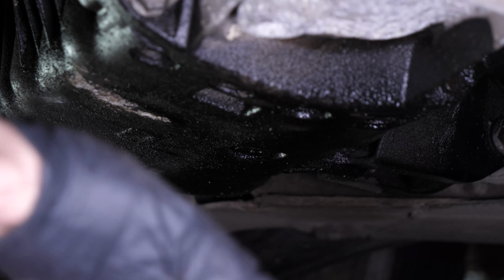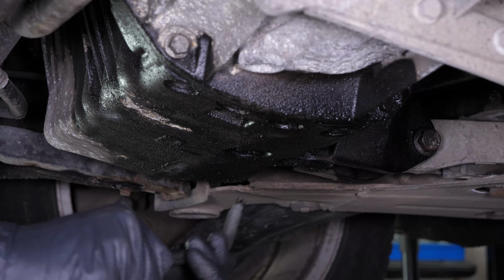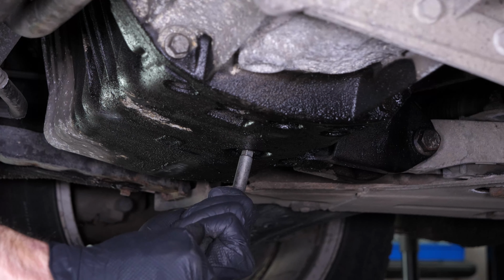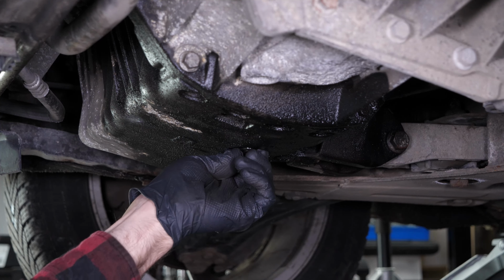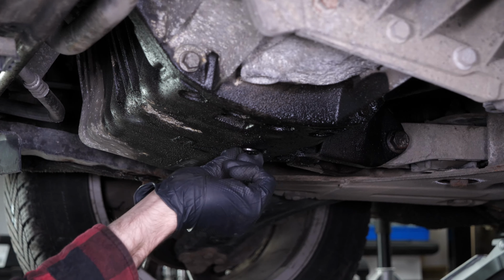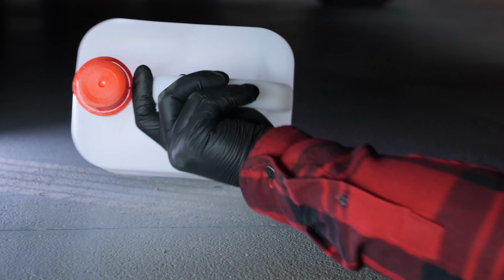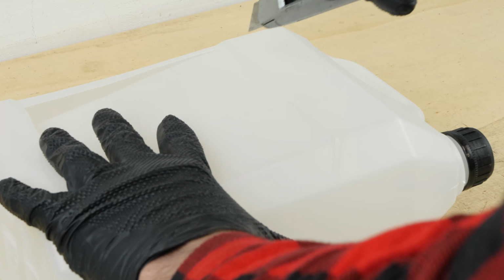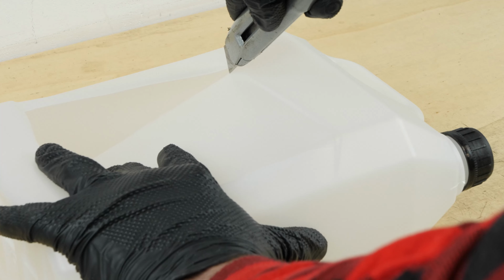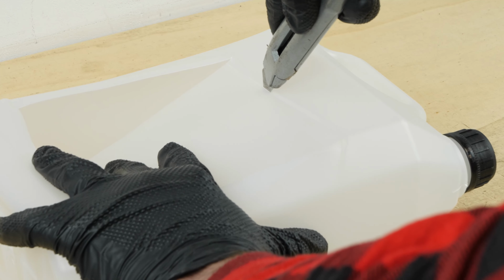You can now see the drain nut. Using an oil service spanner, unblock the drain nut and finish unscrewing it by hand. Be careful on the last few turns of the screw, the oil can squirt immediately. You have to anticipate this by placing a container underneath to collect the oil. You can learn how to make one by watching another of our videos, how to make a collector for liquids.